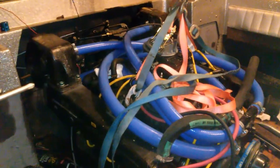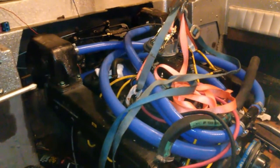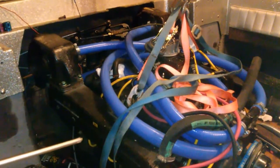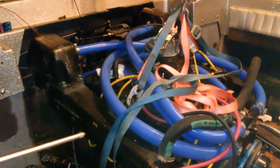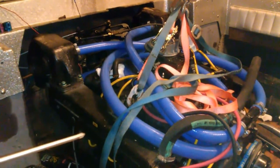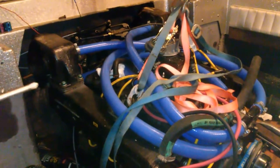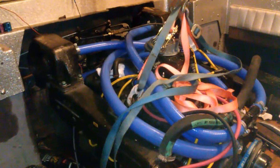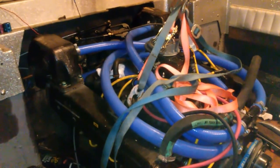The Y tube on this one is missing — I have it on my workbench and I'll show it to you in a second. Normally the Y tube would go down and around and bolt to the gimbal, and that's where your exhaust is. The newer models have those shutters up high on the top of the Y so they're really easy to get to.